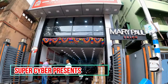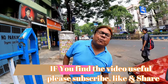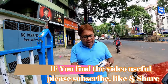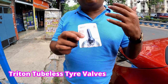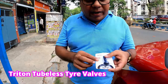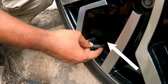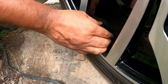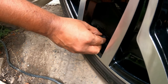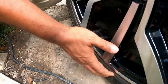Good afternoon, we are going to show you how to change your tire valves. These are tire valves and this is a very critical component in your tire. Once it goes old, cracks appear here. Cracks have appeared around this particular valve and if the car goes over a pothole at great speed or hits a bump, it may give away and your tire may fail.